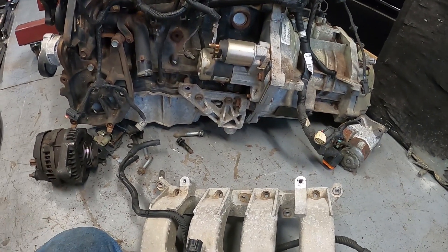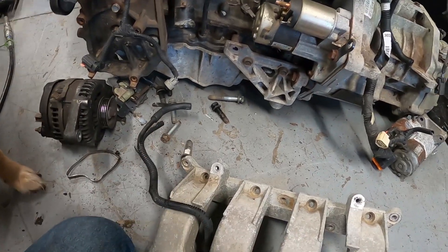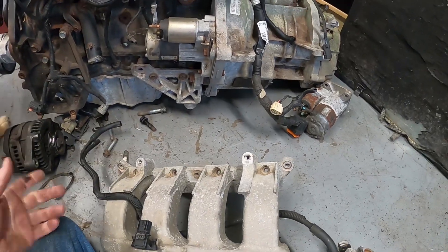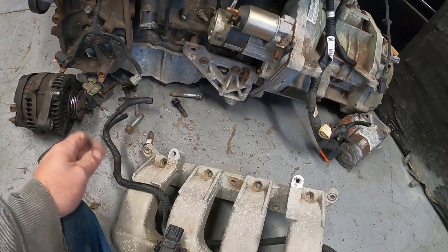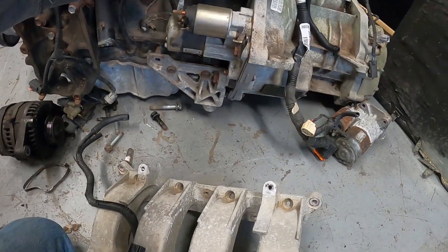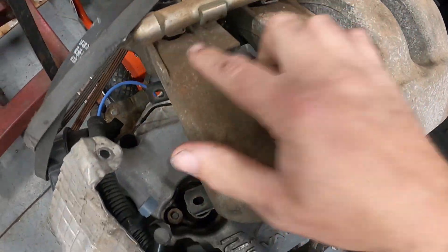This gets placed onto the cylinder head. I've never had this problem but I've seen it happen — people tighten this down and end up cracking these ears off on the ends. I've also seen these things stripped off multiple times. If you're over-tightening and stripping that out, it happens. This is what it looks like when it has a fuel rail and a fuel injector seated into it.